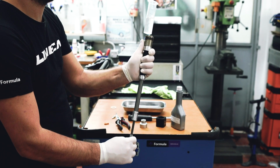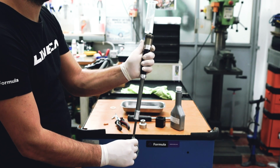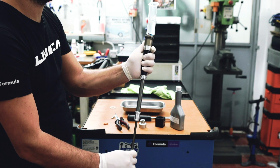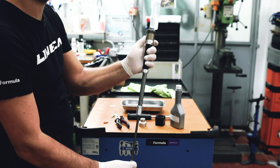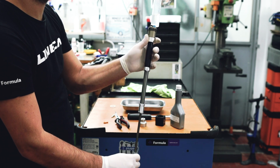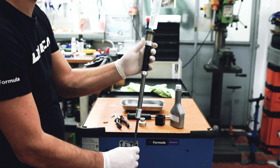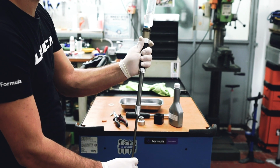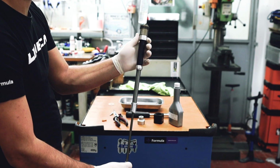After this, place the cartridge in a slightly inclined position, grasping the area of the bladder with one hand. Continue to slowly push the piston up and down while carefully rotating the cartridge at the same time, gently pressing the bladder with your hand. Repeat this for at least 12 reps.